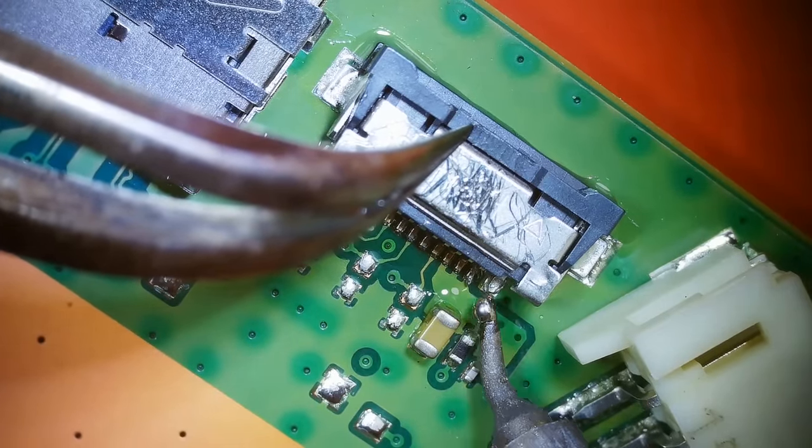I just need to desolder these two wires — add a little bit of flux, then the black wire and red wire. The nice thing about these boards is they're even marked with B and R. I'm going to install this into a disk drive that came from an Xbox Series X with a faulty motherboard. Three screws, desolder those wires, remove the ribbon cables, and we can install the new one. Hopefully this one is going to work — it would be really nice if I didn't have to replace those chips, but if we do, it's not that difficult, just kind of annoying.